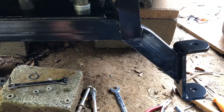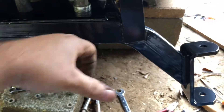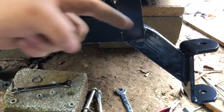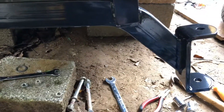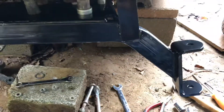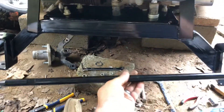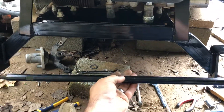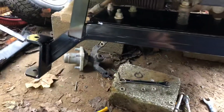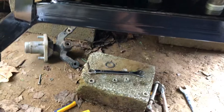It's too much weight to be sitting on those little spindles that angle down. Any kind of forward or back momentum, anything like that — those little spindles are going to bend. Get the kit with the bigger tie rod that comes with it, because it is massive. And if your cart is like mine and has a little age on it, it's probably going to need it — it's probably going to be bent. Thank y'all.